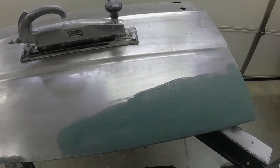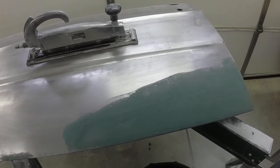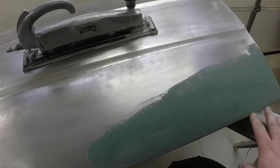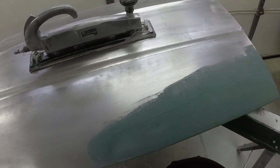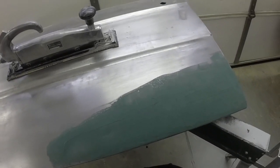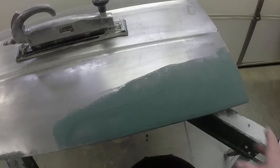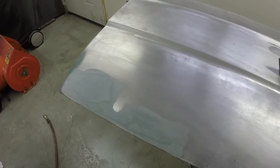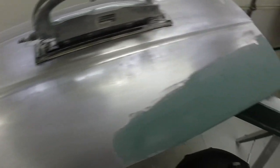Working on the door some more today — this is day two or three. I hit it out with the air file and I had a really high spot, so I cleaned out the filler and bumped it in and then refilled it. This is basically starting over. I just want it to look nice. That's pretty much all ready for a little body filler.